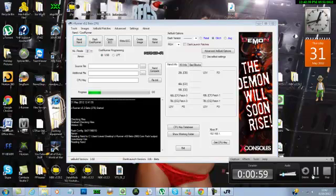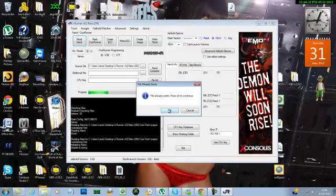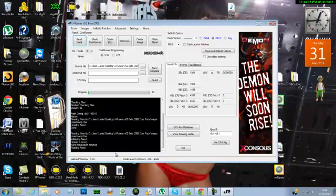It'll progress up to 3FF and that's when you know it's done — it'll make a sound. I already had NAND 2 in there so I clicked OK through the prompts. JRunner automatically reads the NAND a second time, so just click OK again if you get that error message. This will take another couple of minutes.